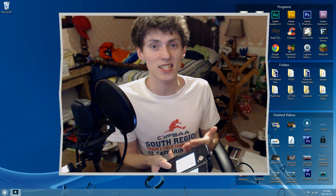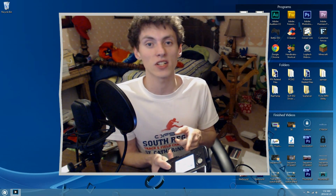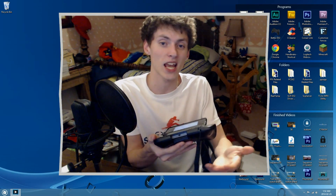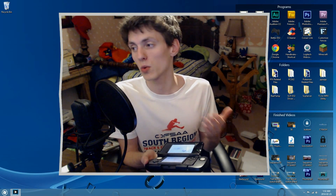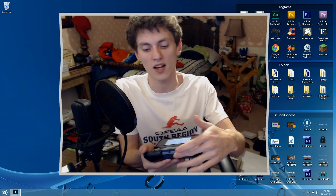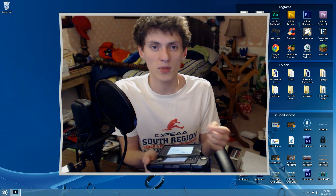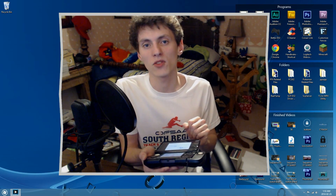I can now have headphones and listen to the sounds because the audio is going through USB, so I can have my headphones plugged into the headphone jack at the same time to listen to the game. Without this revision, you normally had to take up the headphone jack, meaning you couldn't listen to the audio unless you projected it through your computer via stereo mix. Nintendo didn't do a great job of grounding the headphone port, so interference comes through even with a noise filter — it's a hit and miss with the headphone jack for recording audio.